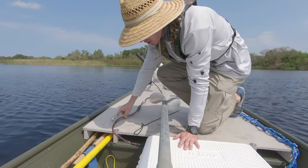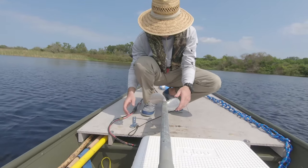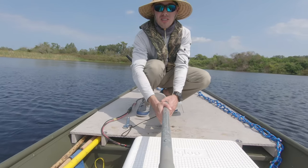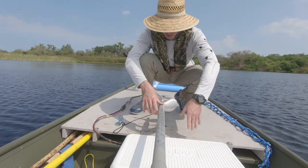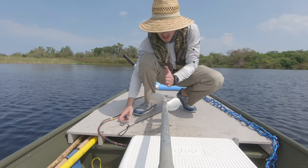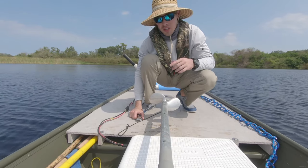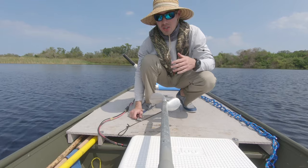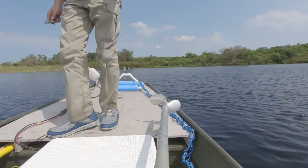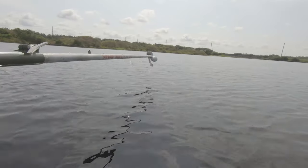The other thing you want to make sure is that this skeg is in line too. Which doesn't look like it's too bad off. That may just be because of how I have the boat loaded. But I got a slight bend to it, so we'll go ahead, spin it around, fire it up, go, and see if it's a lot easier. So start.